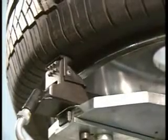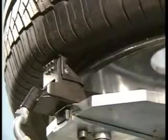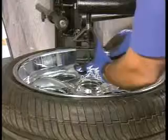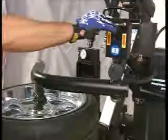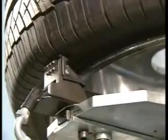The bead assist attachment can be used to aid in clamping stiff sidewall tires mounted onto the turntable. Insert the wheel pusher tool into position and place it in the center of the wheel and lower the device so the wheel presses downward onto the turntable claws and lock claws.